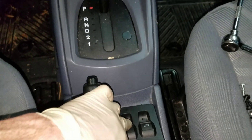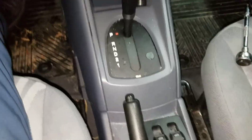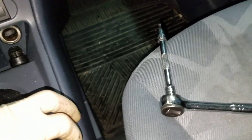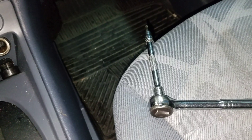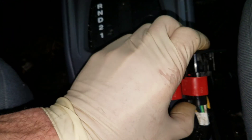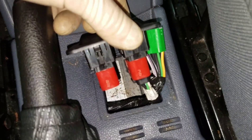The other side is working perfectly fine and we still have nothing on the driver's side. The switch is not carrying a load, so I'm going to pull it out. Lucky for me these switches are interchangeable, so I'm going to plug the driver's side window into the passenger switch — and there we go, the window is working! So on this one we just have a bad switch.